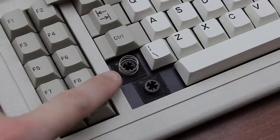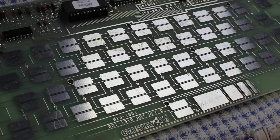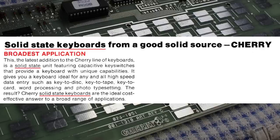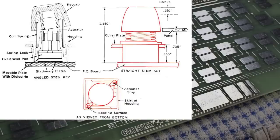As you can see, it uses an external coil spring, and this hints towards what the switch is actually based on. It's actually a foam and foil board, so a more descriptive name would be Cherry Foam and Foil. 'Solid State Capacitive' doesn't even make sense because the switches use moving parts, so of course it's not actually a solid state keyboard. But the name was a lot cooler, and they must have thought so too, because in a contemporary diagram of the switch, they tactically refer to the foam and foil parts as an 'over-travel pad' and 'moveable plate with dielectric.'